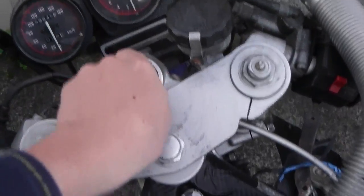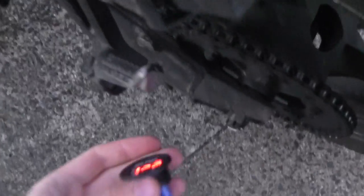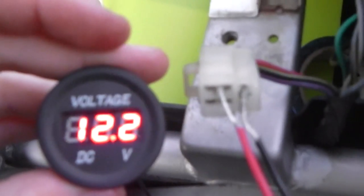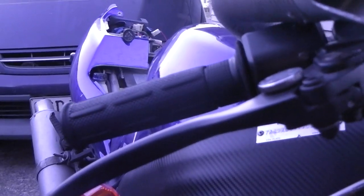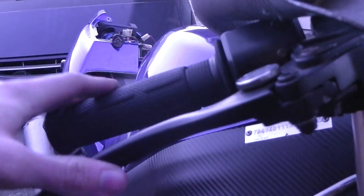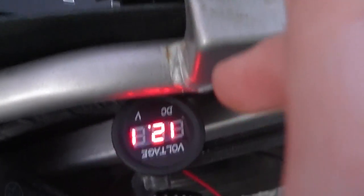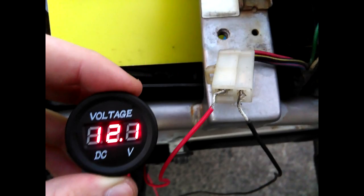At this point you need to decide where you are going to wire your charger clusters to. On my bike I found it easier wiring to the tail light, however for you you may find it easier wiring to the headlight, the instrument cluster or maybe even the main wire loom. If you decide to wire to your tail light please make sure that your positive connector is also wired to the main positive connector of the tail light. If you splice it to the secondary positive wire the light will turn on when the brake is pulled. This is why you want to make sure that the wire is plugged into the main positive cable.